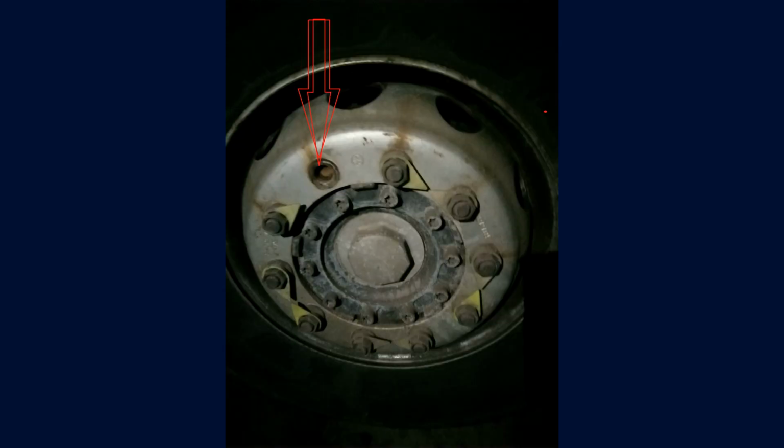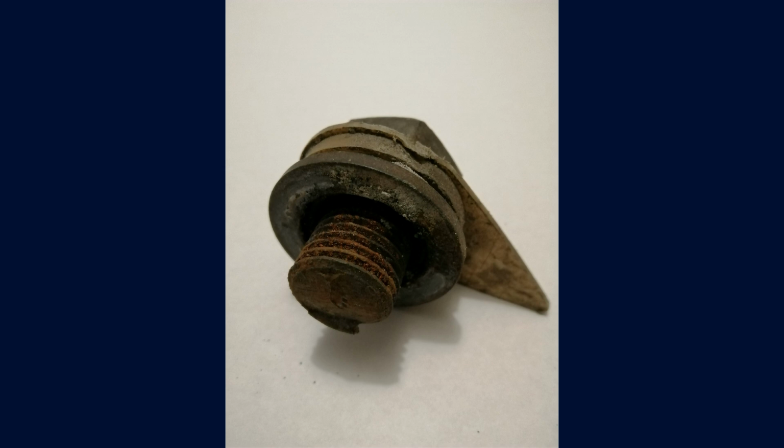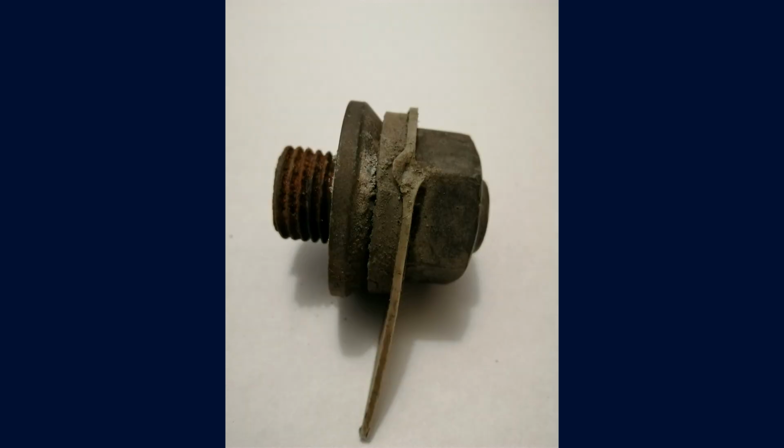It's also important to ensure the wheel is properly aligned with the hub and is well balanced, as uneven load distribution can place excessive pressure on the studs. Additionally, repeated tightening and loosening of the nuts can cause the studs to lose their strength, making them more susceptible to damage. If the studs are made from low-quality material, they will be more prone to corrosion and mechanical failure.